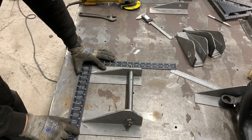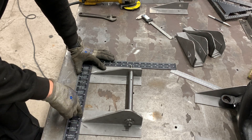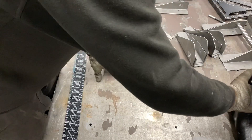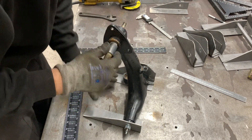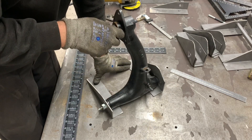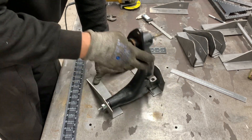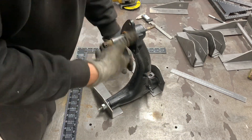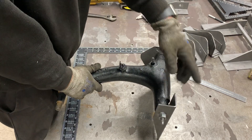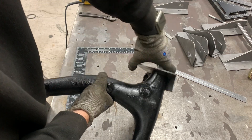If there's any slight difference, just touch it up with the grinder, because we need these four to be right - this is your datum point, this is what's going to sit on the table when we come to fit them to the car. I'll keep arms in stock and check it on every set. As long as we've got clearance there, we're good, because this one's only ever going to move up and down, and this one's only ever going to toe out on the rear. Tolerances are tight, I want this point as close to the chassis as possible, but we've got clearances.